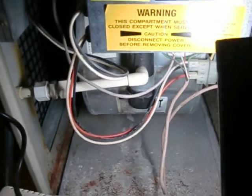Inside the middle of the blower it's a bit hard to see — I'll try to position my light and camera. In here is the AC motor in the back. Hopefully you can see the capacitor with the blue label on it, right here. This black cover with the wires — they look white in this light but they're actually chocolate brown — two wires going to this capacitor.